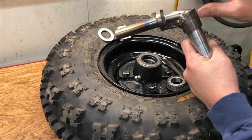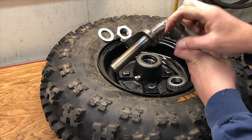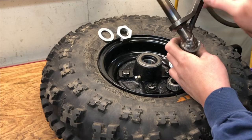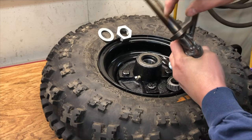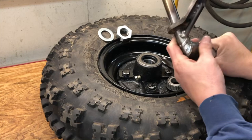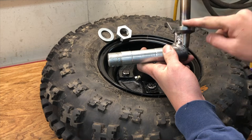The spindle's been cut off quite a bit, bored with a three-quarter drill in the center, and notched quite a bit with a die grinder to get into the bend on the spindle. There was only about an inch left of material on the spindle. I know it's kind of a shame to cut off brand new parts, but I really wanted to make something beautiful and strong — and brand new. I didn't want any wear on a used shaft; I wanted brand new material to play with. These new ones were thicker here and I really thought that was a good selling point. So a lot of TIG welding passes later to fill that up, and I also added another small piece of 3/8 round bar here to really make the connection strong between the steering arm and the spindle shaft itself.